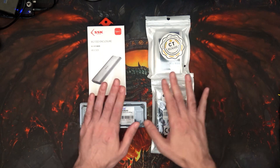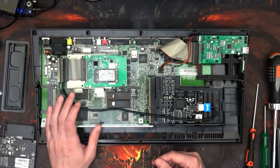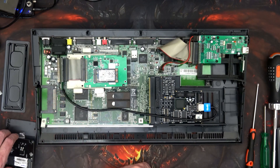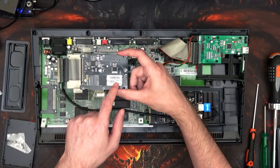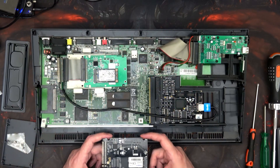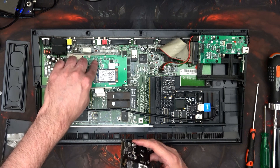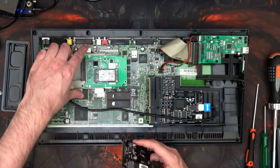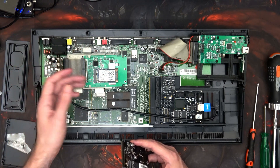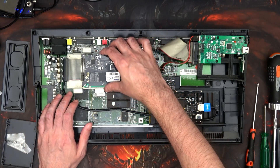Let's remove the stuff from the packaging and stick them in the Amiga. As you can see, here's my M.2 setup — I'm just going to replace it with this. I've already put the M.2 drive in the adapter. I've got to swap it over and test installing it. What I've done is used some double-sided sticky pad things to hold it down to the hard drive cage, which of course doesn't want to come off now because I wasn't thinking I'd ever go back in and swap it.